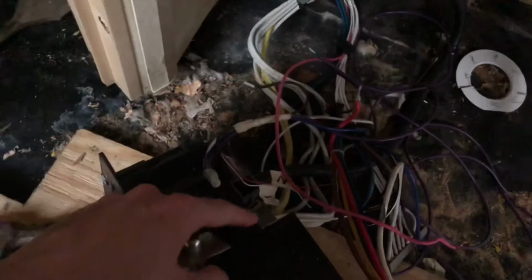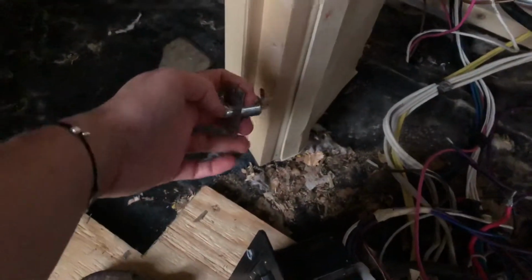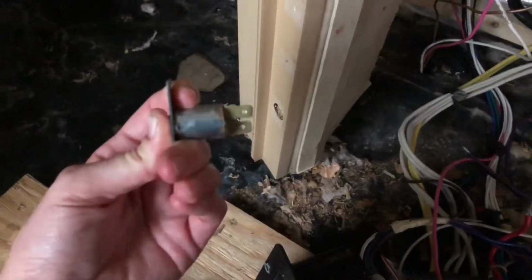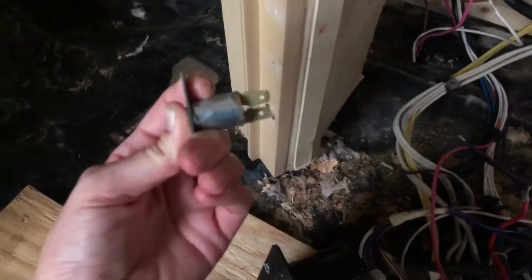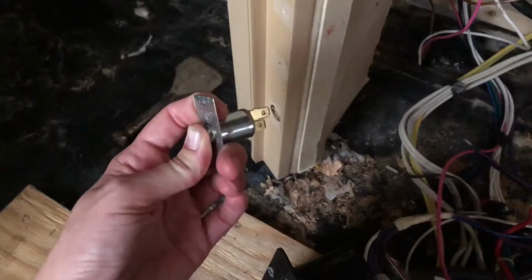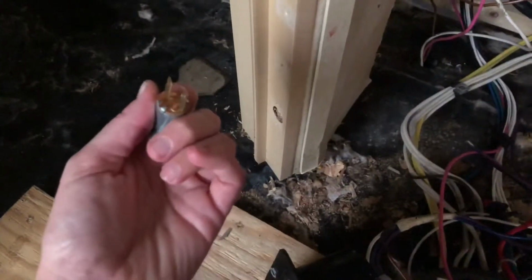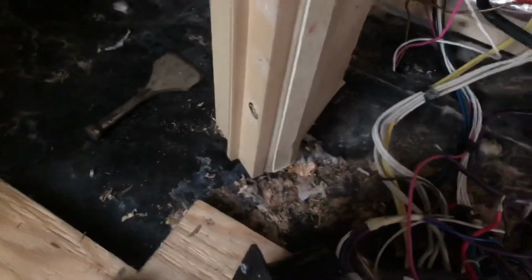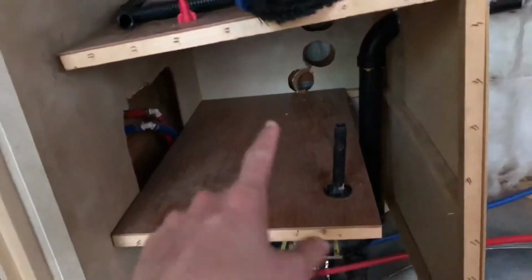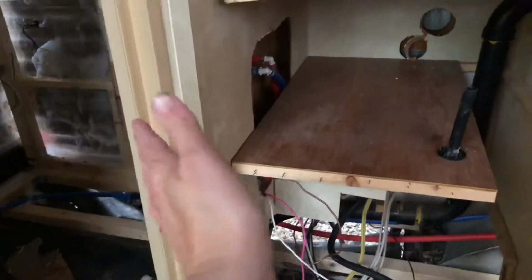So that was a positive wire coming out of the DC side of this power box here. And when the door was closed or partially closed, there was a connection. So there was power going to the furnace. But when the door was wide open, this released and it broke connection in the positive wires, which turned the furnace off, because this is where the heater furnace was, and then over here was where the door hinges were, so it would open like this.